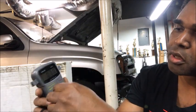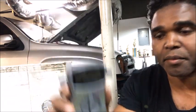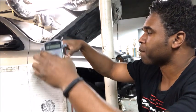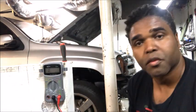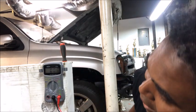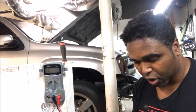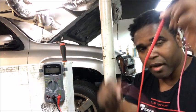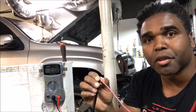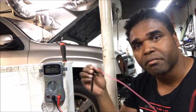With the gauge, I'm going to turn it to 200 ohms. We here at the Garage Shop use the most sophisticated equipment when we do testing. First, I'm going to test the gauge by touching the positive and negative together — I should get a 0.5 or something like that. Getting a 0.5 — alright, that's good. The lower the number, the better. Now I'll take one end of the wire with the positive and the other end with the negative, and I should still get like a 0.5. And there it is. The wire is good, it has no breaks in it.